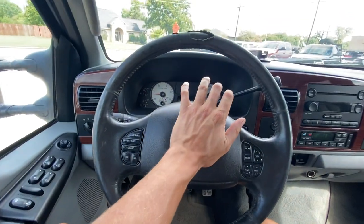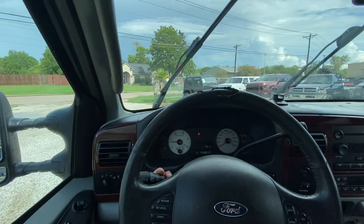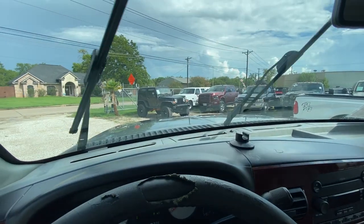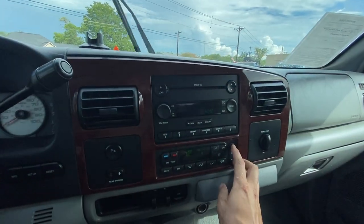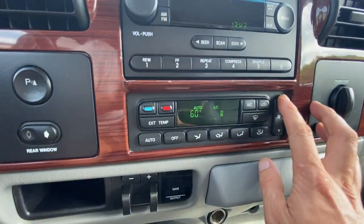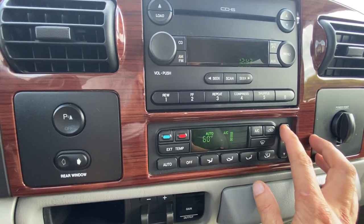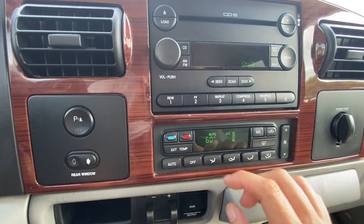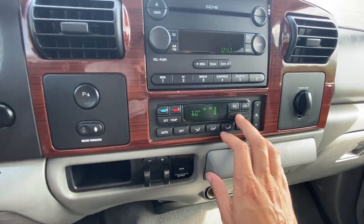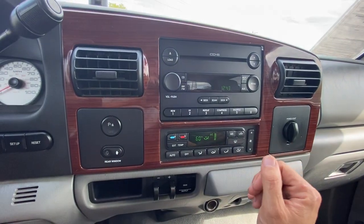Here are our brights. I can't get anything from the sprayer — could be empty, or just need a pump motor. More than likely empty or a broken line. We'll test out all the different blower speeds to make sure they're working properly. Got all the blower settings working. We'll take it to the floor — switches over really quickly. Helps to defrost. Ice cold AC, it's already cooling off for us.